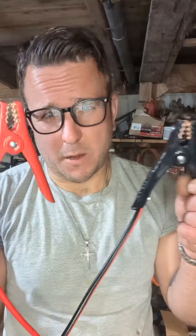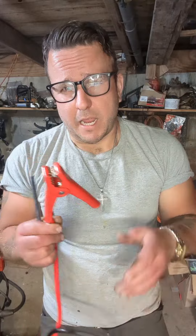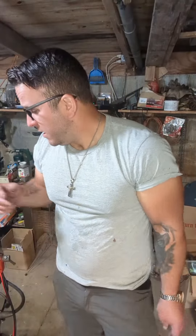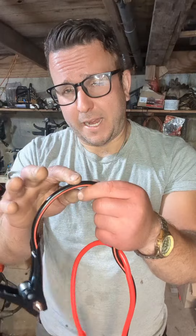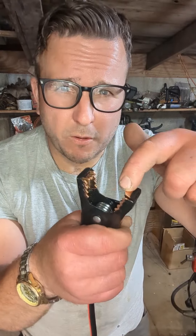That's because the aluminum corrodes really quickly, or the copper electroplating wears off the steel part. I'm going to show you in this video how to make these amazing and how to make them last your entire lifetime. You could take a $12 pair of jumper cables and make them work excellent forever. You might be thinking, why not just spend a little more on all-copper ones? My friend Jason spent $160 on a pair of 100% copper jumper cables off Amazon. The wires were copper inside, but they quit working after 10-15 times the same as the others — because the clamps were still electroplated steel. So they completely ripped him off.